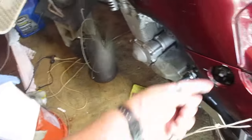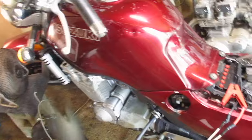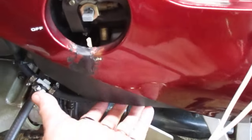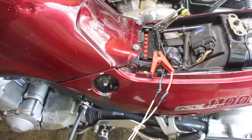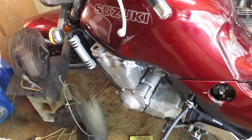I pump it out every day, pump it fresh — I call it feeding it intravenously. That is treated fresh gasoline with carburetor cleaner in it, so when it goes into the carburetors, it's going to clean out any rust that came from the tank. Also, under the side cover here I've got a $40 fuel filter, one of the very best made.